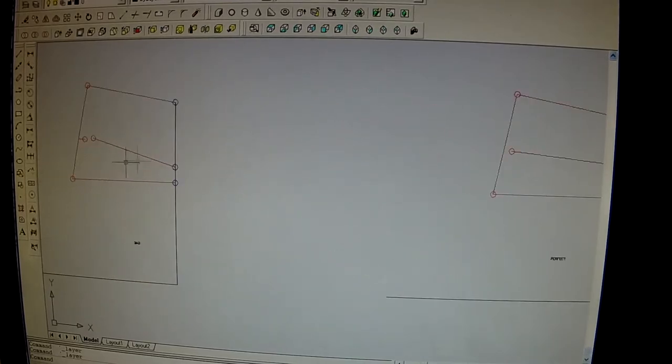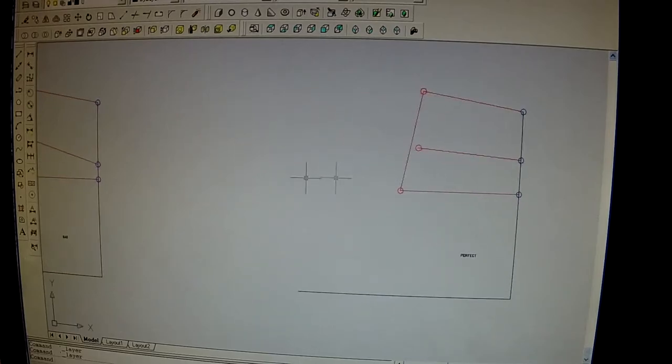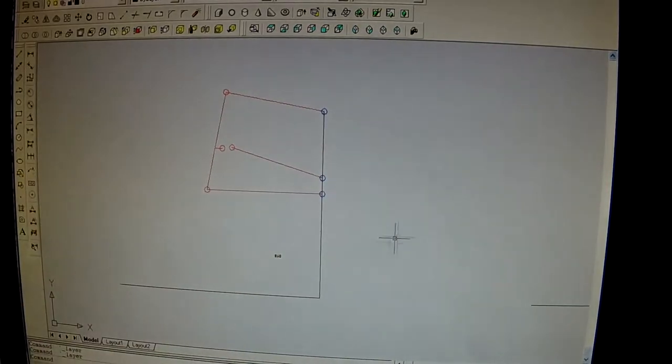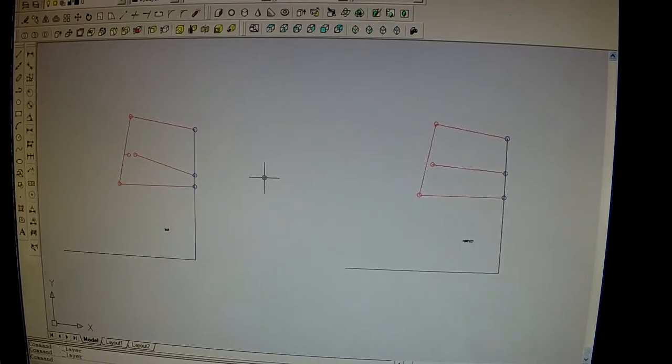Anyway, that's how I did it. I went from the horribly bad, undriveable geometry to this, which is how it is now. It really was a difference of just raising that one pivot — I had to raise it up maybe a little over an inch. And that made all the difference in the world. Geometry is very important when it comes to designing your front suspension.